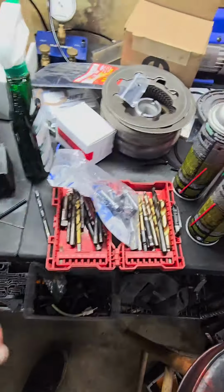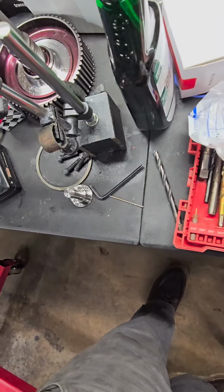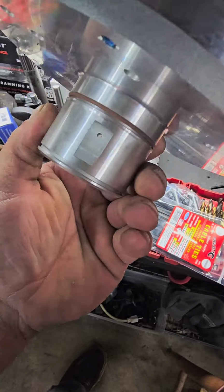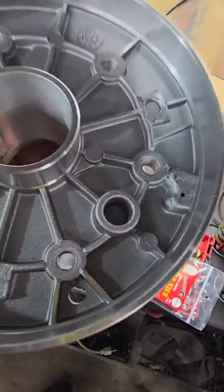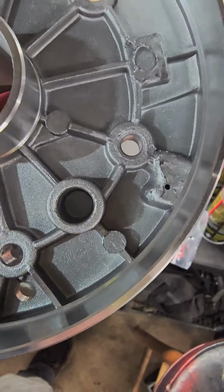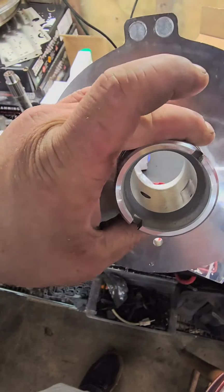And then we're going with a Sonnax overdrive piston support, with the O-ring on it. Before I install this, I enlarge these holes to 100 thou, 100 thou, 100 thou. The second thing you want to do is make sure this check ball is sealing really well. I'll fill this up with some ATF and just make sure that check ball seals. Hear it dinging around. If that check ball doesn't seal very well, you're going to be in trouble when you don't have any overdrive.